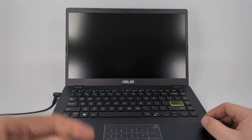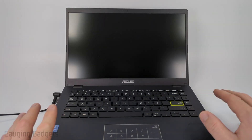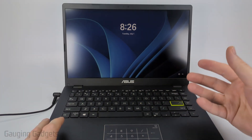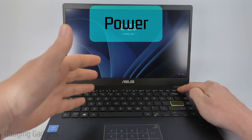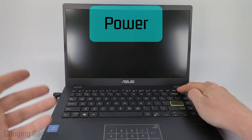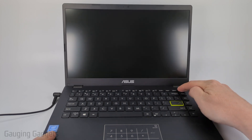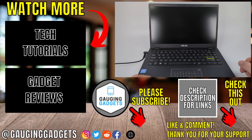If nothing happens, don't worry — there's another step that usually works, and that's going to be a hard reset. Don't worry, no files will be deleted. My laptop isn't having this issue, but I've turned it on so you can see what this will look like. All you need to do is hold down the power button for around 30 seconds. You should see the backlight turn off or the fan stop spinning once the laptop turns off. After it turns off, hold it down for another 5 to 10 seconds, then let go and hold down the power button again for a couple of seconds, and it should turn back on — and you have performed a hard reset and fixed the black screen error.